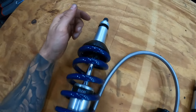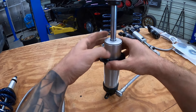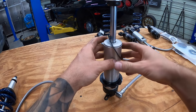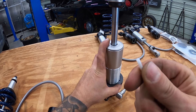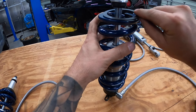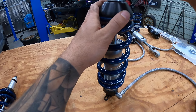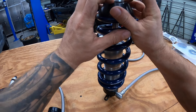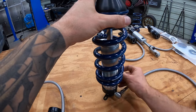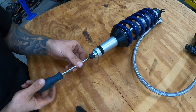Here's a little trick: crack this loose, and then rather than just ratcheting your wrench, tighten the ratchet on the Allen key side — it'll just loosen itself. You're holding the nut while tightening where your Allen key is. My shocks are about 300 years old so there's a little rust in the top of the Allen head there. You're going to have your steel collar, and there's the shock. To get it out, just compress the shock down and bring it out — you may have to finagle a little but it'll come right out.